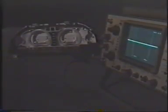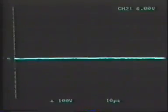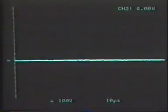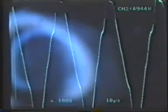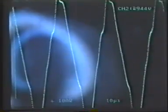Finally, let's review some of the key points in the combination meter inspection. First, you must remember that a high voltage is applied to the combination meter when it is turned on. As you can see, the voltage is as high as 940 volts. Therefore, when you remove the meters from the automobile for inspection purposes, you must be especially careful.